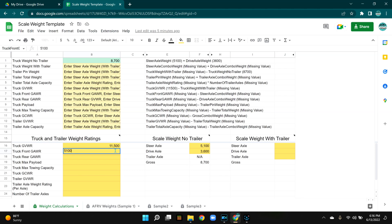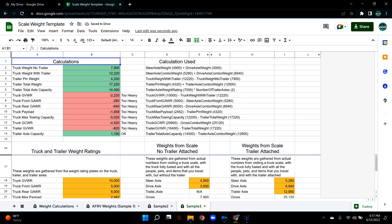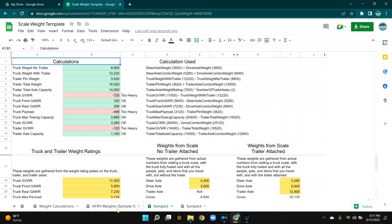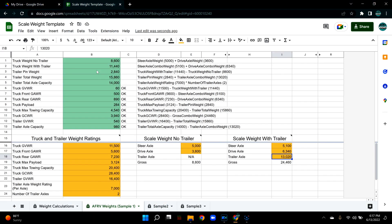The process of fueling up with the app and weighing your truck with the app is really simple, and I highly recommend looking into both of these apps. I'll put a link in the description to the spreadsheet I'm using — it does all the calculations to tell you whether your vehicle is within the appropriate weight limits for the truck, trailer, axles, and payload. It requires a couple of weighings: first just the truck, then fully loaded as if going on a trip, then again hooked up with the trailer.